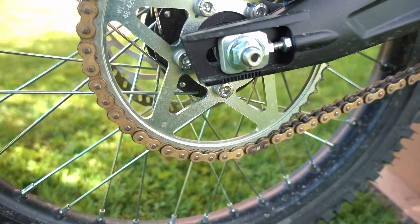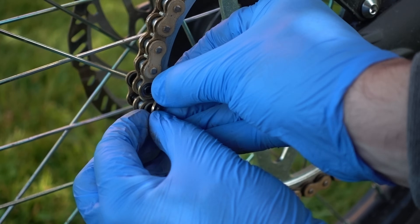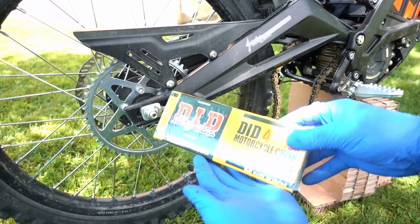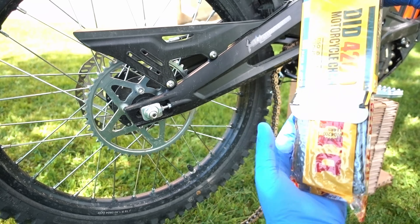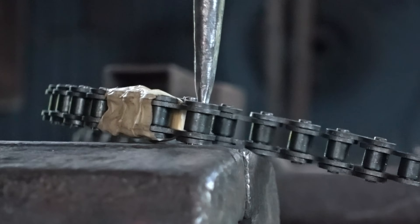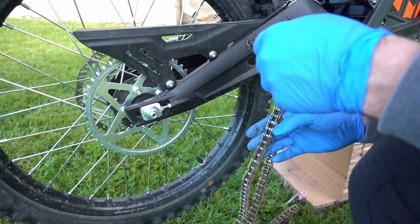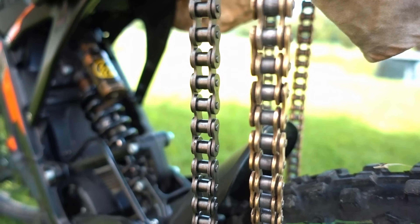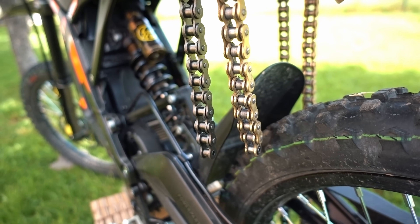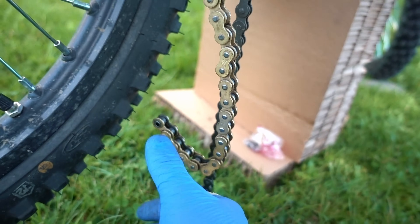My bike is so fresh that I still have a cardboard stand. Let's find that joiner link. Here it is. Let me remove it — I'll try not to lose the 4 rubber seals, 2 on this side and another 2 on the other side. Here is the DID racing chain — the joiner link and chain itself. It is quite long, so I'll have to shorten it from 106 links to fit the stock 48-tooth sprocket. Next, I'll fish out the factory chain from the jack shaft. Let me compare the two. The main reason I am replacing the chain is stiffness caused by rubber rings inside each link on the factory chain, hoping to achieve higher top speed and better range with less friction on the drivetrain.